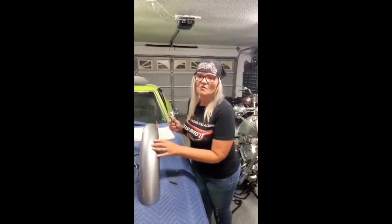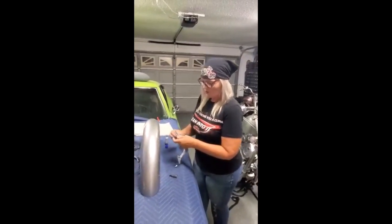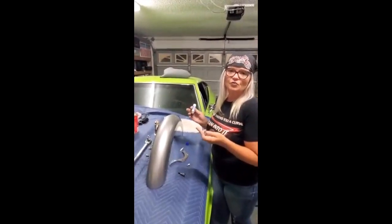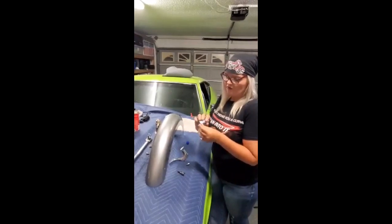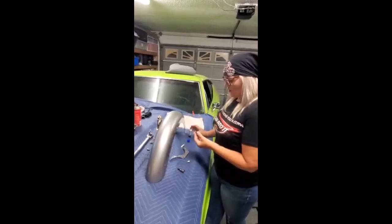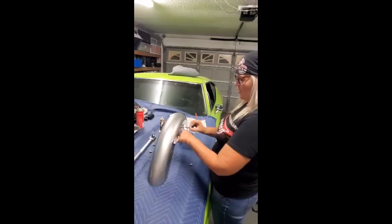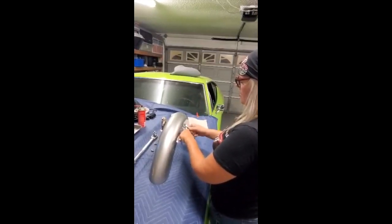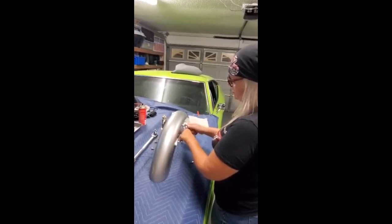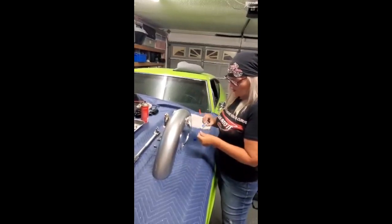It's time to start moving on this Big Dog fender. We're going to put this bracket in here — these brackets are nice and shined up. We put the bolt through the hole, but before we do that, remember the Loctite. We're using blue Loctite. There's different kinds: there's blue and there's red. The red is very permanent and the blue is really sufficient for this kind of work. Just put a little bit on there — a little goes a long way, ladies. We put Loctite on there, put the bolt through the hole, line it up, get our allen wrench ready, and very gently make sure it's in the hole and spinning through the threads. You should not have to force it. If it is difficult, something is wrong and you need to stop and make sure what you're doing is correct.